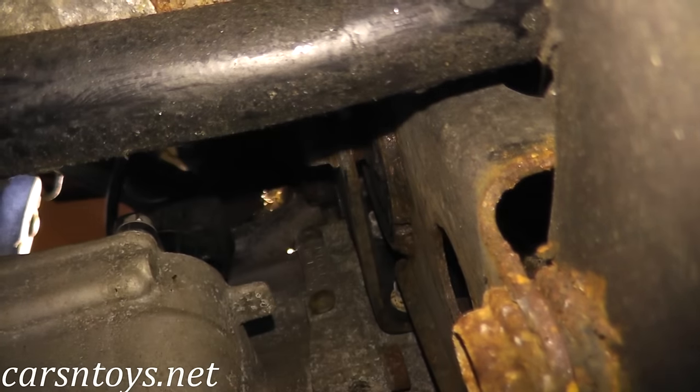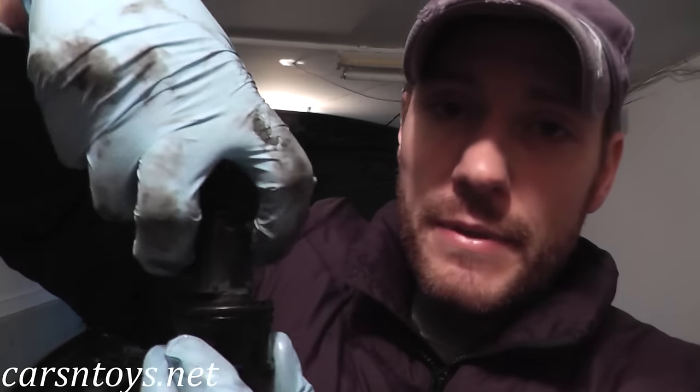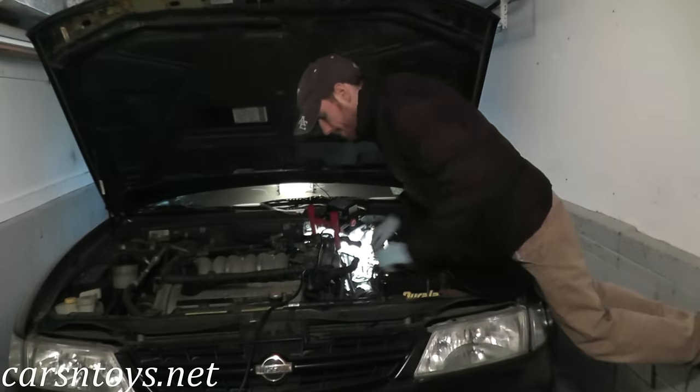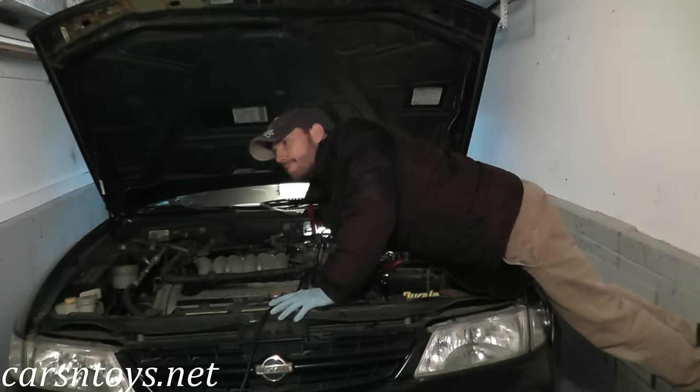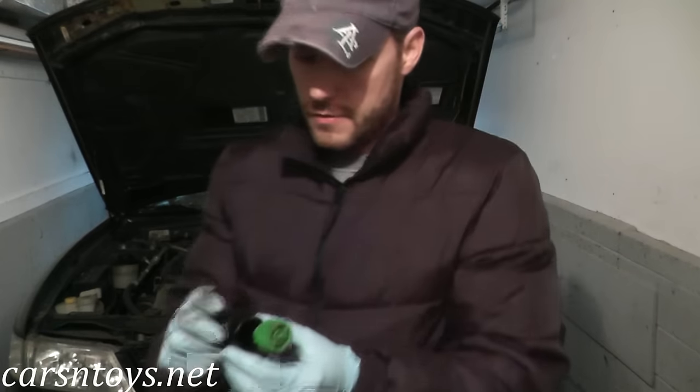Loosen up the bolt and now we're going to lift the sensor from the transmission. It's really hard to get a good shot in there, but this is not easy to remove. What I did is clamp my fingers around the sensor and twist it, because this body of the sensor sits down into the top of the transmission. You need some strength — grasp it, start to twist, wait until it starts moving, then pull it up. It took me a good 35 to 40 minutes just to get this out, so be patient.